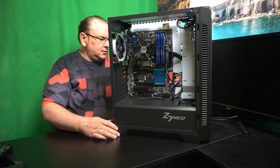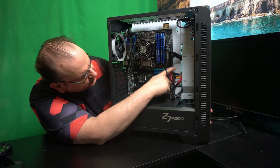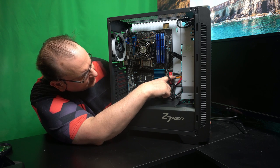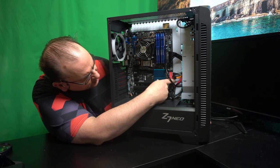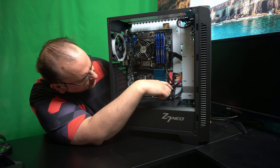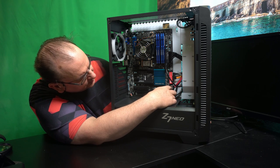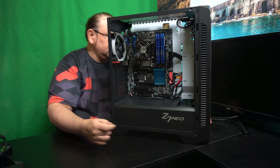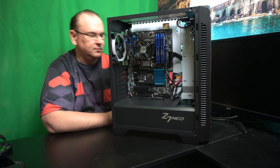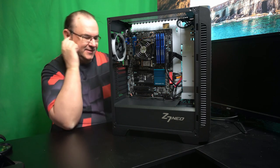So now that I've connected them, I decided to do one small change. The RAID configuration will be on this first connector. On the second connector, I'll put only one of the other hard drives, because one of them's already been used by the onboard drive, and then I'll put the other hard drive here on this group here. This has quite a lot of controllers. It has three different SATA controllers on this board, so I can actually distribute the load.